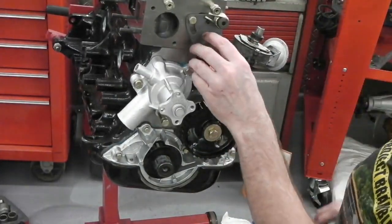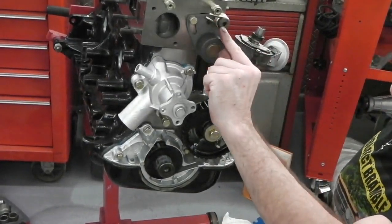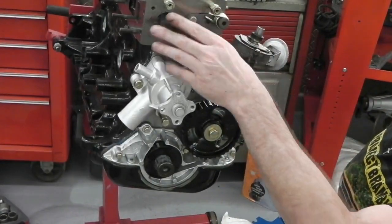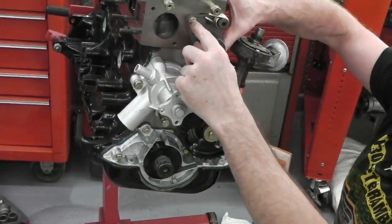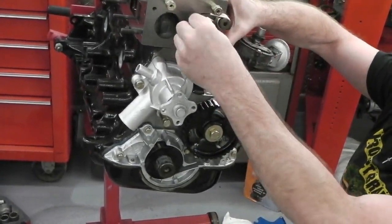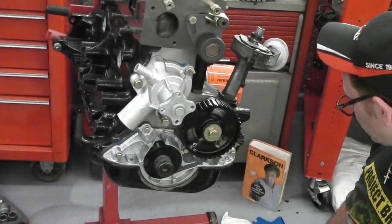Spring cam belt tensioner, spring goes there. You've got a little mini Torx type end to lock it. You load the tension up by pushing back, locking that bolt on, fit your belt, release this bolt, and the idea is it springs back. We got rid of the idea later on.